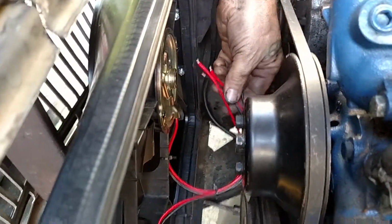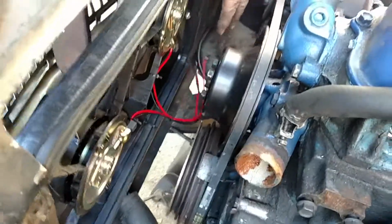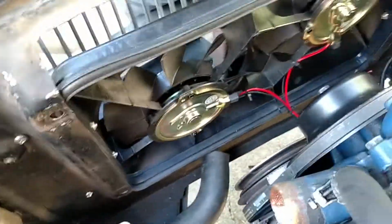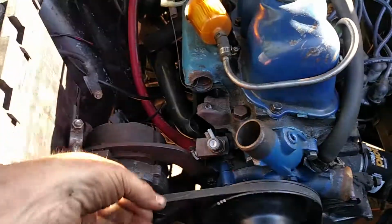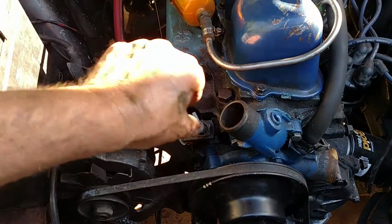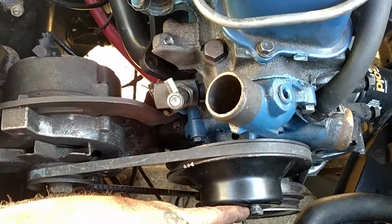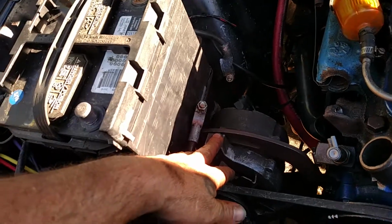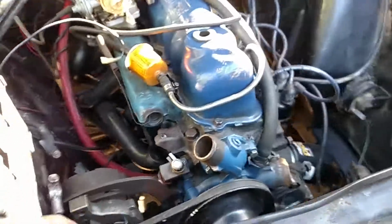It's a 1650 cubic foot per minute or whatever fan. So it's barely gonna be enough, but it fits right in there. I'm putting in a Maverick radiator, so it's gonna be a little bigger. I'm trying to figure out the hoses. Problem I'm having is it's doing such a sharp turn into the motor, like a little tiny 90-degree turn right here when the radiator's in. So I can't fit the original stock fan blade. Can't really fit the alternator very well without probably moving the battery into the trunk or over to the other side, which I didn't feel like dealing with.